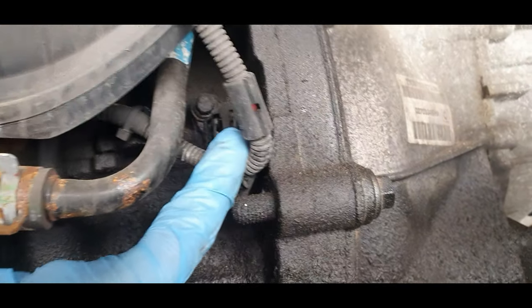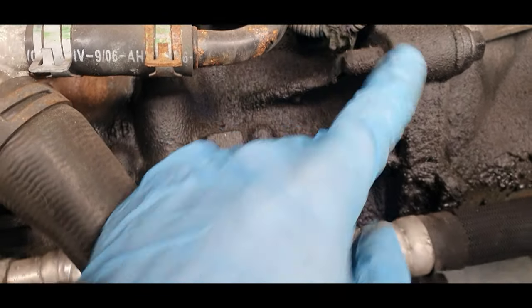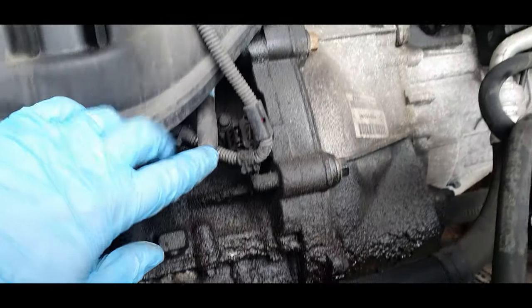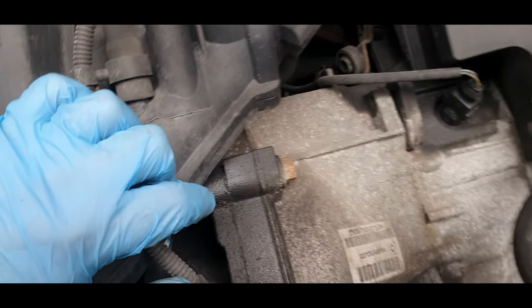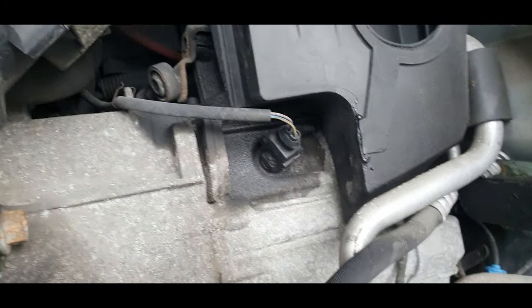Normally it leaks from that sensor there, the crankshaft sensor, I think that's what they call it. I'm sure you guys will correct me. I did research it. It's a common fault that it leaks from there, but looking at that, guys, it goes further up. So the harness is wet around this, around up there.